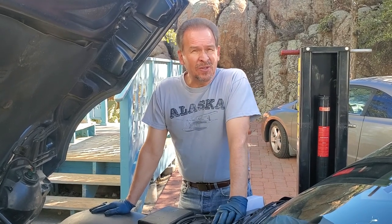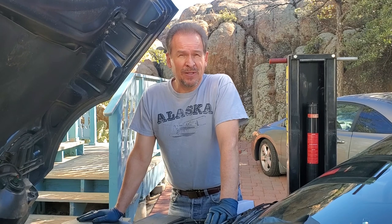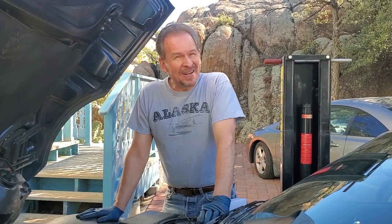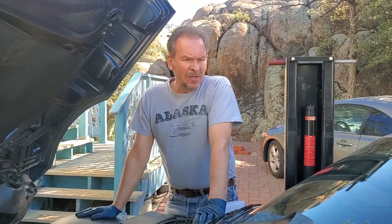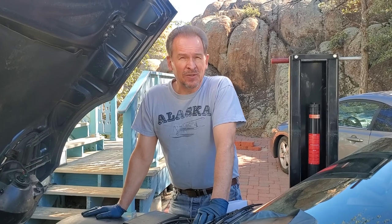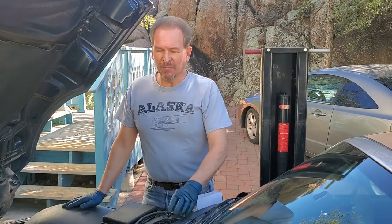We're going to choose this because our son happens to have a car that his wife drives, and after taking it to a local repair shop, they had no code answer either, and they tested all the solenoids and found out the variable valve timing solenoid was bad. And in looking around on the internet, we find out that these solenoids can go bad at like 40,000 miles. And this particular Solstice, our second one we've had, has about 109,000 miles on it. And we didn't own it from new, so we don't know if it's ever been changed or if it's on its second one or if it's on its third one. So it probably needs one anyway. And if you're wondering, why would it need one? We'll show you that in just a moment.